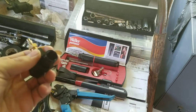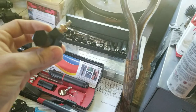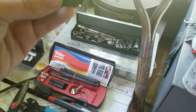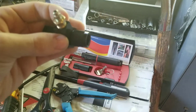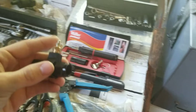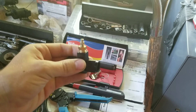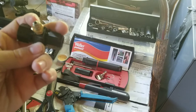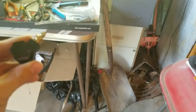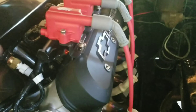The main thing to get all this to work is this piece here. I ordered this from AN Hoses Direct — it is an AN-6, basically a T fitting with two 1/8 MPT female ports on it. My fuel pressure sensor will thread directly into the bottom port here. I'm also going to be throwing in a bleeder valve — basically just a brake caliper bleeder — which can withstand the 58 PSI easily. I also ordered a little cap here. And this piece is just a leftover from where I installed the cap on the end of this fuel rail, which is where this whole setup is going to be going.